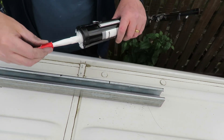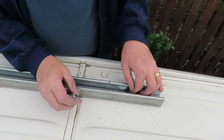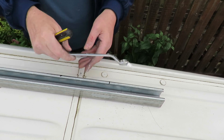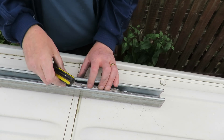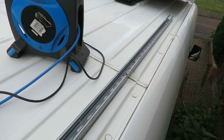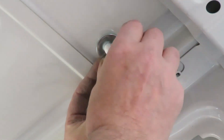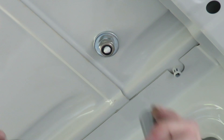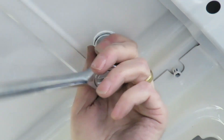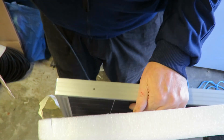This was going to be my preferred method of mounting. I couldn't put them at the sides where the channels are for the roof bars because of the size of the panels — the brackets were either an inch too short one way or an inch too long the other. So I've drilled the holes in the roof, put the bolt in, and I'm jamming a screwdriver in there to hold the spanner while I go inside and put the nut on. I've put four bolts in — M8 bolts and nuts — using nylock nuts on the inside to give it a solid fixing so it doesn't come off.